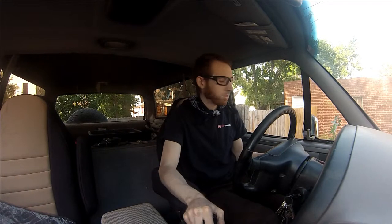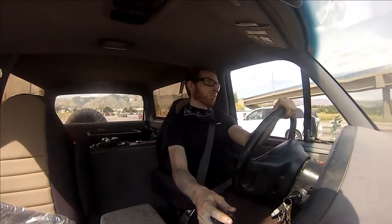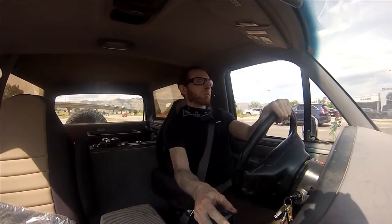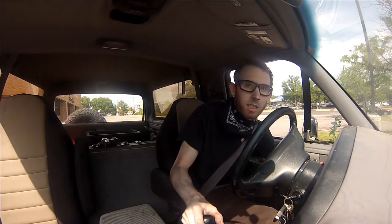Seems to be running good. I drove the truck around probably about 50 miles, because even though I'm not using any kind of fancy fuel additive, I still want to get the catalytic converter hot so it burns off all the impurities most efficiently. I also topped it off with gas to have the cleanest gas possible in the tank. Time to go test the emissions on this beast again — hopefully we get a better result this time. I passed! That's awesome.